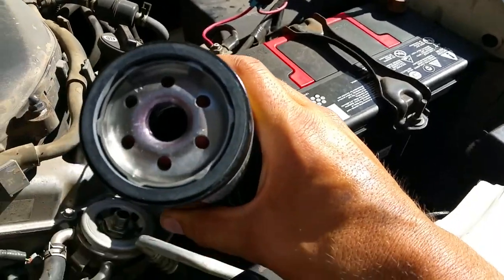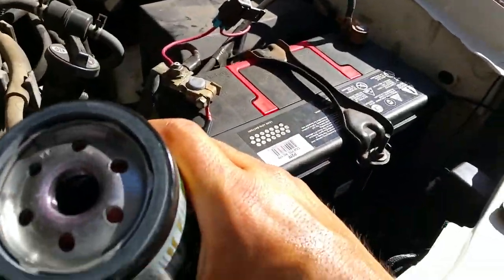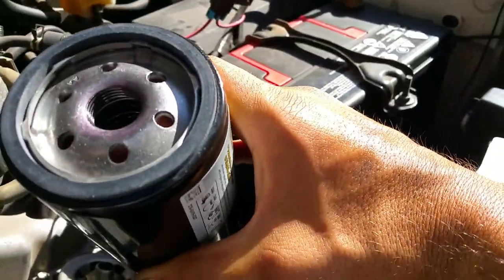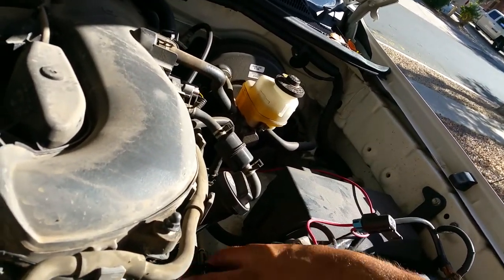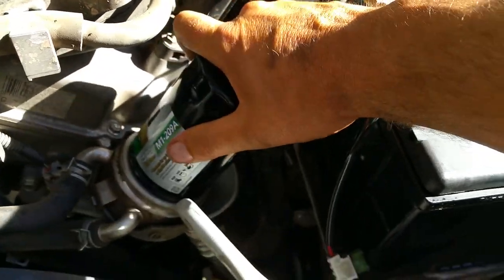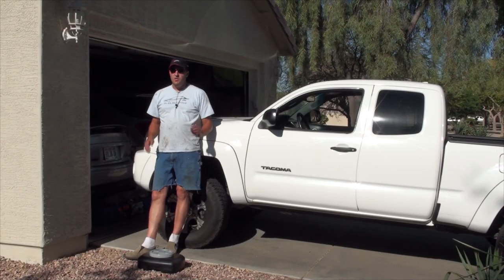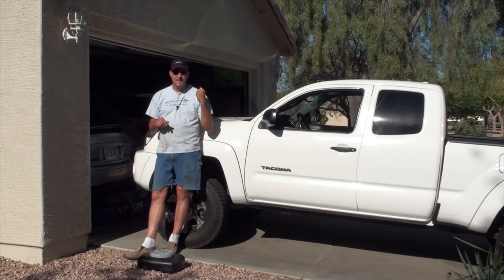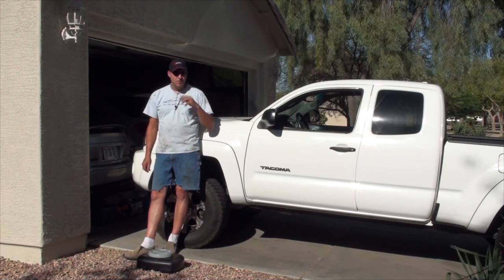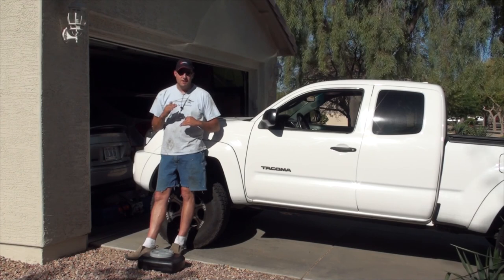I used my trick of filling the filter up with oil so it would already be pre-filled to a degree and get pressure faster than putting it in dry. I only filled it once because not all of it absorbs into the filter material — there's a little bit left at the bottom, so I expected a small spill, but the hose is there to catch it. Lost a little bit but not too bad. You don't have to gun these on really tight — just snug, because they will tighten up over time. The oil has been changed successfully. The Royal Purple is really hard to see on the dipstick because it's so clear and transparent once on there — look for the shiny film. With the proper oil filter and anti-drain-back valve, the oil pressure light isn't staying on for a second or two when I start the engine anymore.